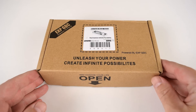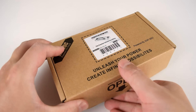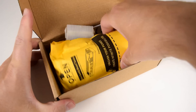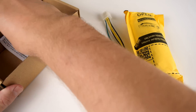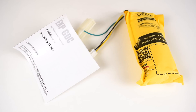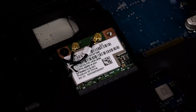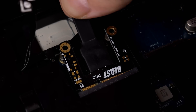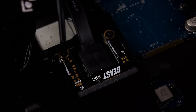Now let's go over the installation process. To connect an external graphics card we're using the EXP GDC Beast external graphics card dock — a review sample that Banggood sent to our YouTube channel. You can find links in the description below. We're using the version with the Mini PCI Express connector. Installing the device is fairly straightforward: you need to remove the wireless card for this to work, then plug in the external graphics card dock. For networking you'll have to use either Ethernet or one of these cheap USB dongles.